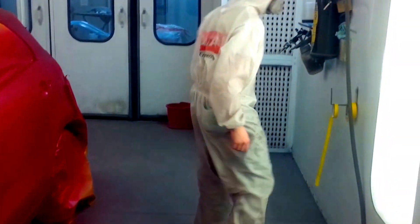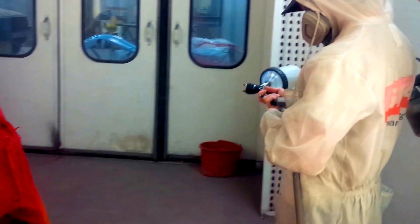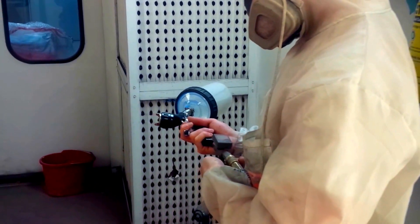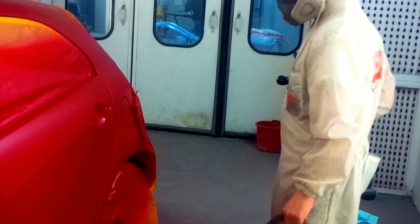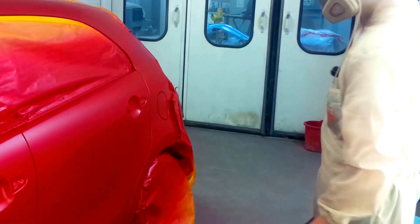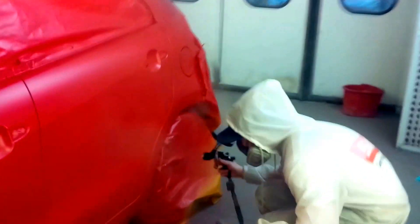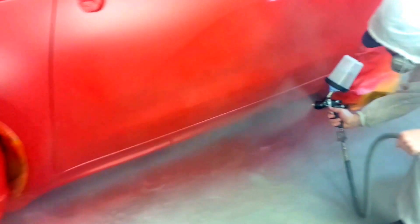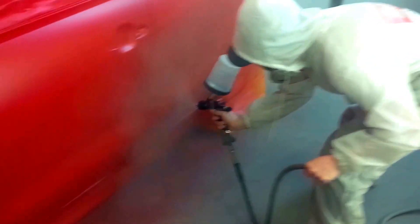I can't remember for the life of me what clear is going on here — I believe it's Glasurit 923-220 but I'm not sure. You can still get the sun gun in there with buckets and stuff, but you should try to clear out all the clutter and keep your booth as clean as possible. There's a rag on the floor, and looks like a piece of tape swinging in the breeze. I leave a lot to pick apart too, so it's refreshing when I get to do it to somebody else. And that hose — I think it's time to replace it. You get a lot of dirt coming off a worn hose onto your paint job, and if you run over it constantly it'll break apart and contaminate your paint, which is a good reason to use line filters anyway.